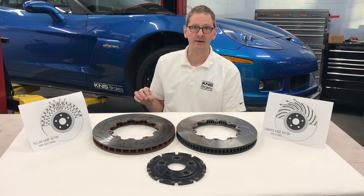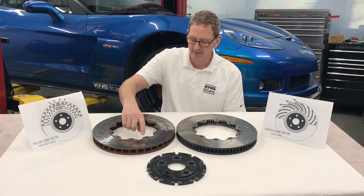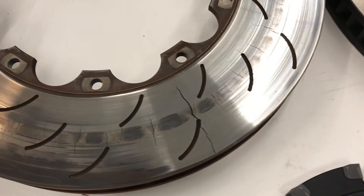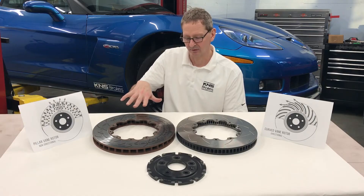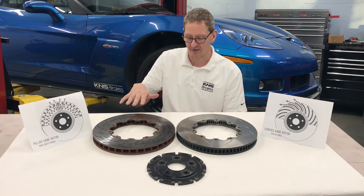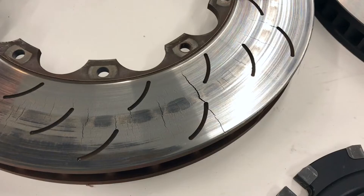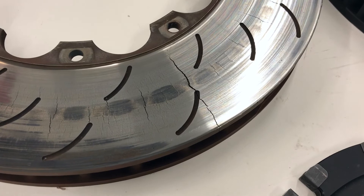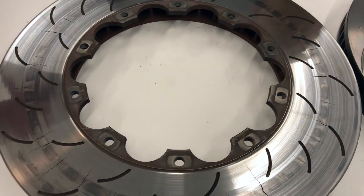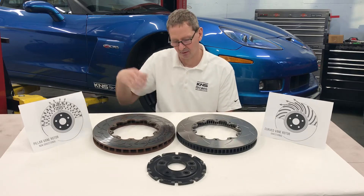What we have on the right here is a factory rotor ring removed from a customer's car, and what you can see is the rotor didn't do so well. There's a crack all the way through the rotor ring, which is pretty premature because overall there's not a ton of cracking, so he didn't get a lot of use out of this — just a few weekends on street tires. The rotor clearly wasn't able to take it. You can also see a little pad smear. There's a significant amount of cracking originating from the edges of the slots, pretty deep, and in this case it's reached the edge of the rotor, which means it's no longer good.